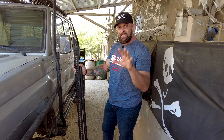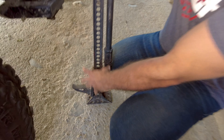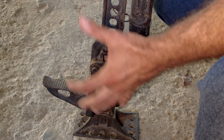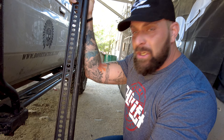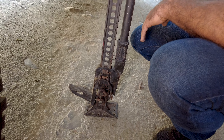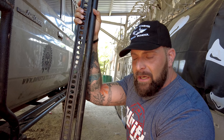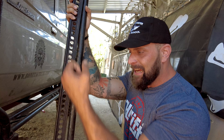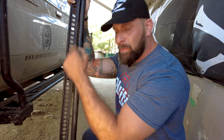There are a couple downsides and negatives. One of the big negatives is that this whole mechanism tends to get really gummed up and jammed up in any kind of humid environment, and there's almost nothing you can do about it other than carry a bottle of lubricant and spray it every time you use it. In a lot of the areas I operate in — like Florida or down in South or Central America — I even have to carry a hammer, because it's not in jacking the vehicle up; it's in letting it back down that it really just gets stuck. You've got to spray it with oil and bang it with a hammer every click you bring it back down.